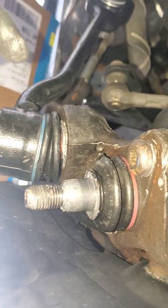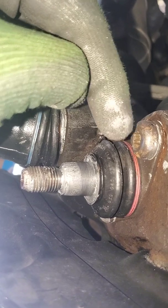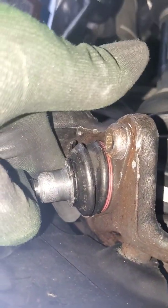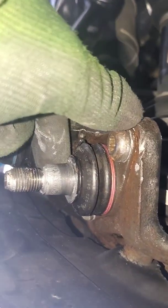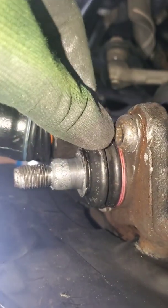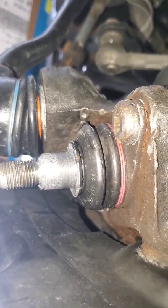Now we have good access to the ball joint. We're going to have to take out these T50 nuts — there's one on this side and another one right behind where my finger is pointing. You got to take those out before you can use the adapter. There are two ways you can use this adapter: you can use the nut as support or the edge around the mounting area here as support. Also, in order for the adapter to fit well you're going to need to remove the rotor so that you can remove this metal shield and get more clearance.